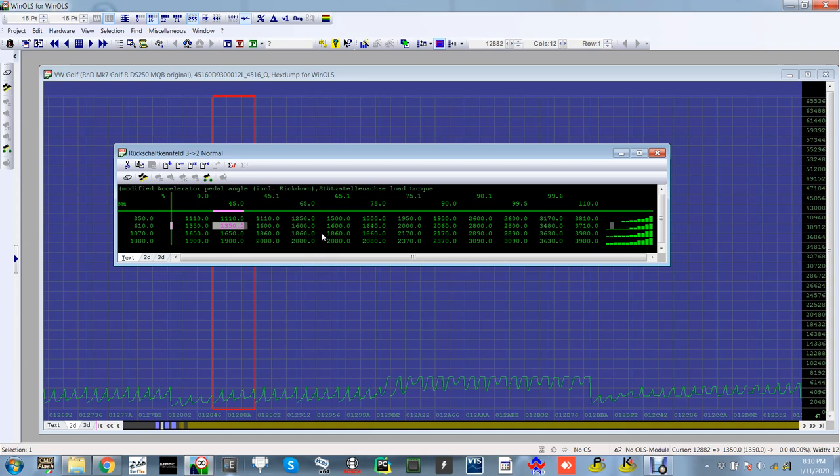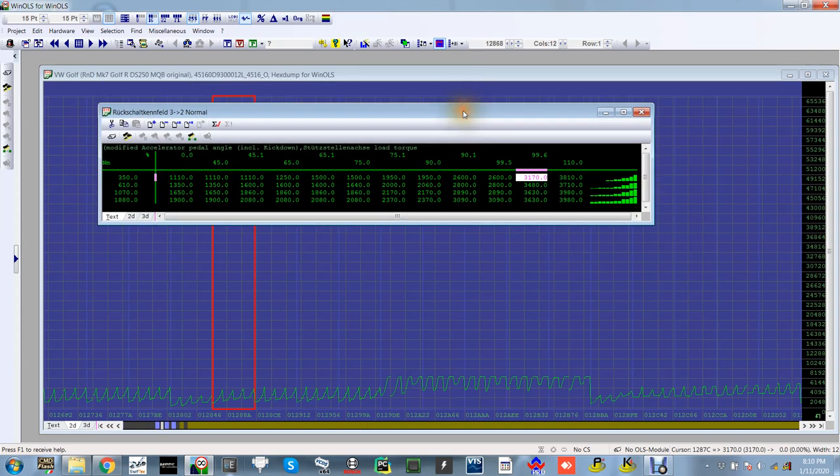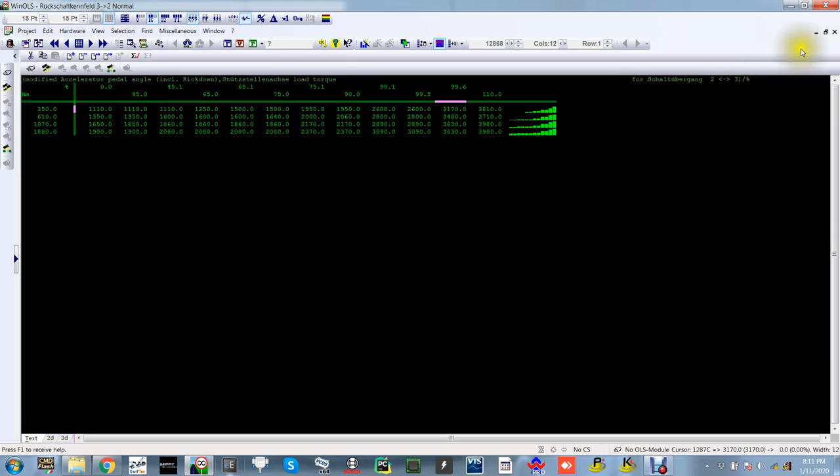There's a shift-up map and a shift-down map. You've got third to second in normal mode and these work exactly the same way — you've got your kick-down, you've got your 100% throttle position, and then you've got Newton meters. You can see on this map the throttle position that tells the box when to change. With a standard car that's great, it's livable, though there might be some niggles. When we tune, we come into these maps and change where the shift point actually takes place. If it keeps hunting between second and third, we log the car and adjust the position of when it changes gear — bump it up or take it down — there are lots of things we can do.